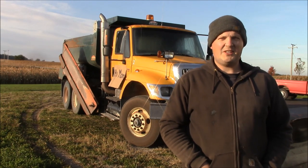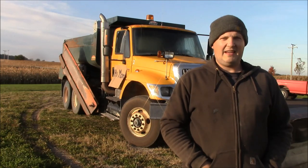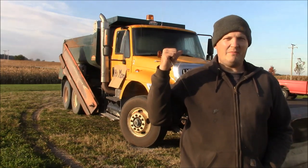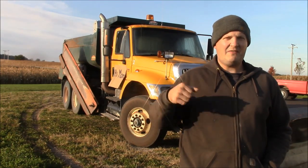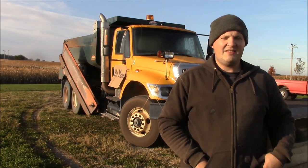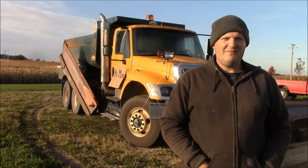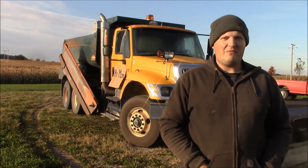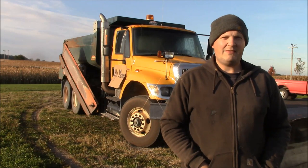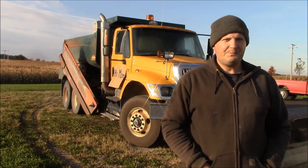I don't know how far we're going to get with that. He told me specifically he doesn't want to spend two or three days trying to figure it out, and it could very well take that. This is a DT-466, and in a 2003 that would have the HEUI injection — more or less like my pickup truck with the Power Stroke engine. The HEUI injection absolutely will not start without a decent battery. If the cranking voltage drops below like 10, 10.5 volts, the injectors won't fire and you'll never get them started. They'll crank and crank but just won't go.